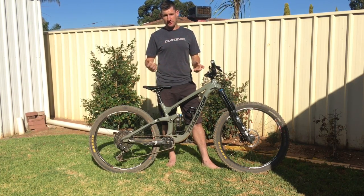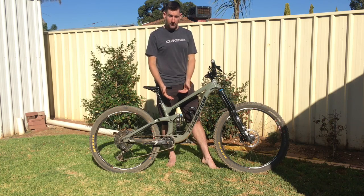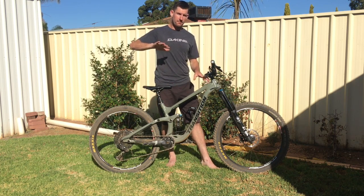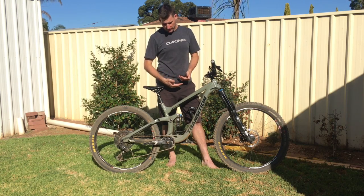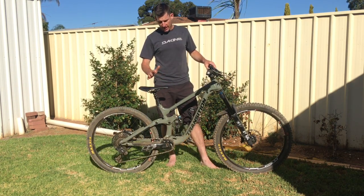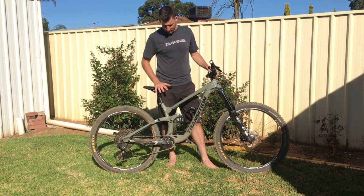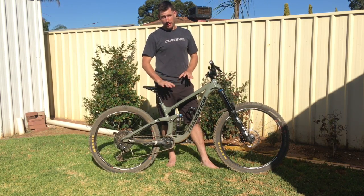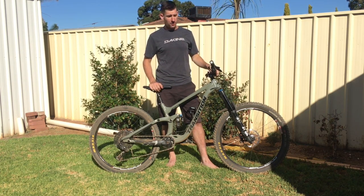The ramp-up's perfect at 178. I don't think I'd go to 180. If I was to go to 185, it'll put me in a poor position on the bike - I'd be standing too far over the front. 178 brings me into the sag, it's probably about 22 millimeters sag. I'll double check that at 178, see what the sag actually is, but it feels great. There's still plenty of clearance. It's not deep in the travel. It's exactly what I've been looking for.